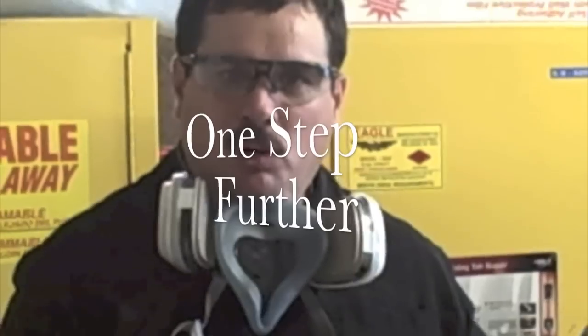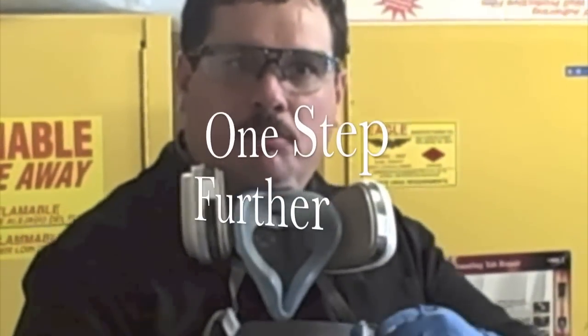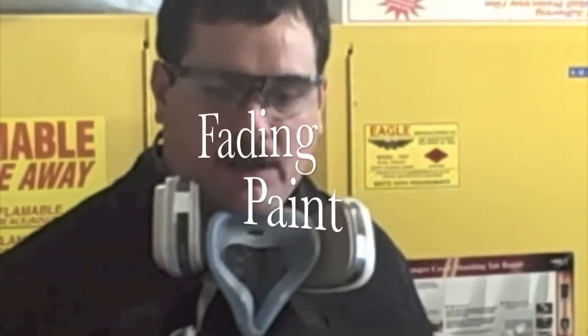I painted what I was originally painting. I went past that a little bit and kind of fanned it out to let that paint overspray blend into the existing paint. Now normally that would probably be good, if that was a matchable blend, but it's not. This is more like a fade. So what we're going to do is cut that one more time with 500 just to help make more of a transparent blend there.